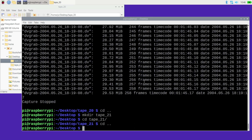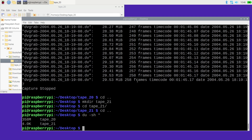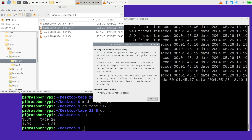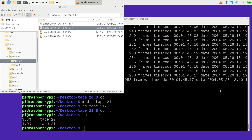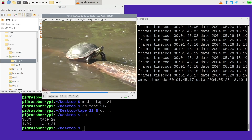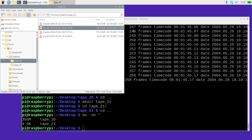If you want to find out how much space this is taking up, type: du -sh * — you can see that tape_20 is taking up 358 megabytes. Be cognizant of how much space you have on your drive. This flash drive is 128 gigabytes so I have plenty of margin, but a full DV tape could take 13 gigabytes. I can actually play the DV files — I have a dual monitor setup so it's playing on the other monitor. DV files take up a ton of room, so I want to convert these over to MP4.